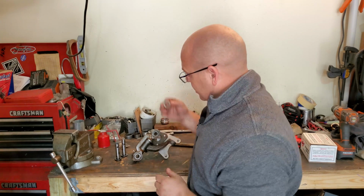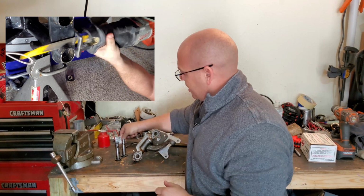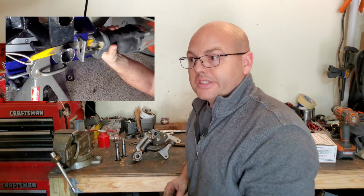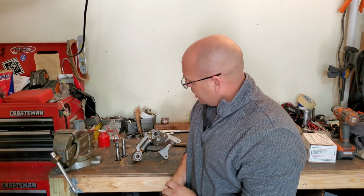Don't forget that we're going to be narrowing that beam, and that's what we're waiting on. We got to get the torsion bars installed and get that correct offset figured out before we can figure out where our shims need to go. The shims I went ahead and stuck in a little baggie right here with some Marvel's Mystery Oil to keep them from rusting up or anything like that. And we have the driver's side still to do. I got to tear apart the driver's side and get it set right because right now it's not right, and I don't want to use that homemade shim that I have in there because that thing's crazy.